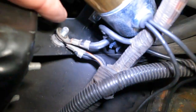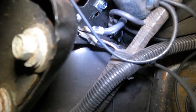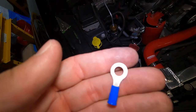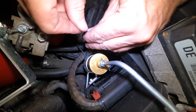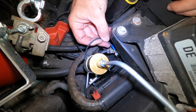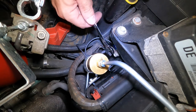For the ground, you take one of the black wires, add the ring terminal from the kit, cut it back, and land it right on the body ground bolt. Do a tug test to make sure it's secure, route it in place, and put the 10-millimeter nut back on and snug it down.